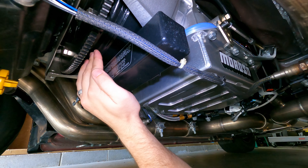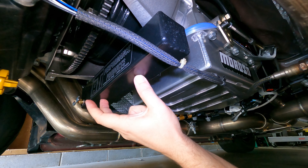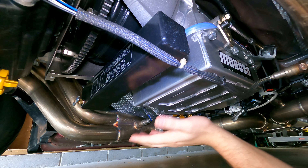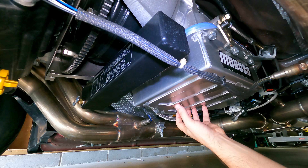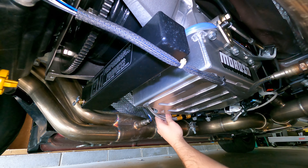So we're under the car now — it's a little tighter under here. When you swap the Turbo 400 in, if you have an automatic, you need to switch the mid-plate to a 2015 through 2017 dust shield, a starter shield. You also need to actually change the starter as well. I have a 2015 starter in here, which is a 3-bolt instead of the 2018 2-bolt. So you have to change both the starter and the mid-plate.